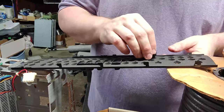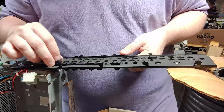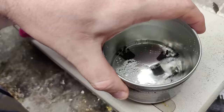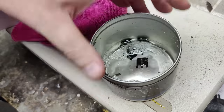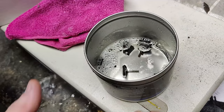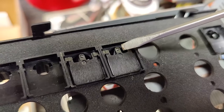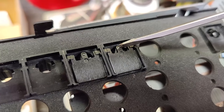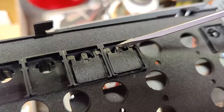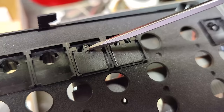Now I'm going to put the keycaps back in place with the new neoprene pad, because they've all been washed and cleaned. For the springs, I just put them in a little bit of Evaporust overnight — that gets any rust off, then rinse them thoroughly. Don't reinstall the actual plastic caps yet; you can get a feel for how the mechanism works, and it's a lot easier to install without the caps. The exception, of course, is the space bar.